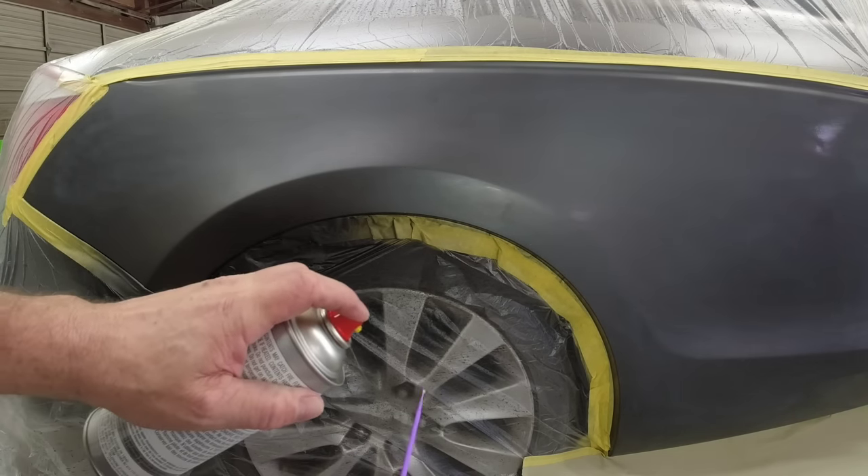This was my first time doing a repair like this with aerosol color and aerosol clear coat, and I have to say this is a really viable option for somebody to do this at home. It's really not that difficult — just follow the instructions on the can and follow the steps I've laid out here. Make sure you're overlapping when you lay down your clear coat and you won't run it like I did. But overall it came out beautifully for what it is. If you're wanting to just clean up a couple spots on your vehicle, this might be a great option for you. I hope you enjoyed this video — if you found value in it, give me a like and leave a comment down below. I appreciate each and every one of you watching, and we'll see you next time on Garage Noise.